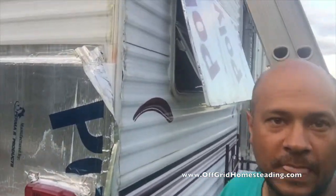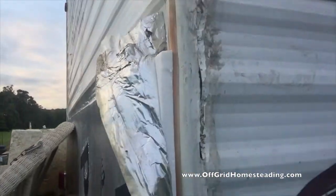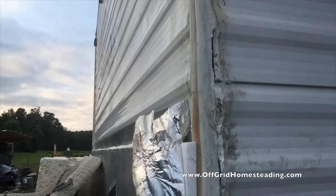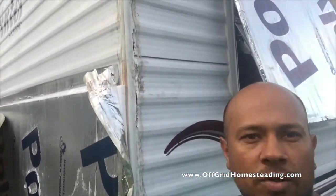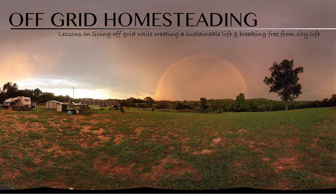Okay, this is the third entry to finishing up this video. After checking outside and doing some more investigation, look what I found. We had a section of caulking that had come off from about here down to here. Our electric plug is somewhere right in this area. That's some of the stuff you have to do to troubleshoot your water leaks and electrical issues in the trailer. That's the culprit — I'm going to get that sealed up. We have a lot more rain coming this week. Thanks again for watching the Off Grid Homesteading channel, hope to see you again, bye-bye.